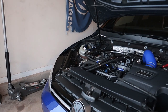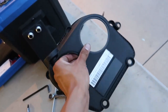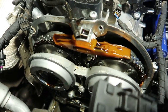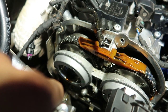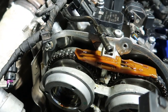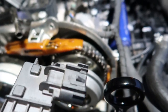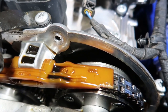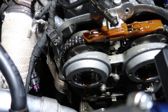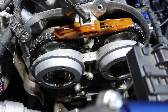Mine looks bad because I had put extra sealant on it. It's starting to get a little dark out, but here's the cover all cleaned up — I took a bunch of brake cleaner and wire brushes to it. Now I'm about to clean the surfaces on the engine. That bottom corner down there is what was leaking really bad. There's a little bit of sealant and dirt to clean off. Down in there you can see the camshafts with the actual lobes. It's not that bad of a job — I'm just inspecting everything and cleaning every surface.